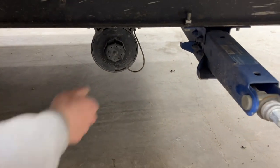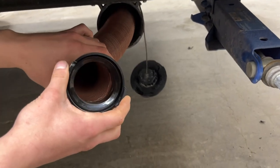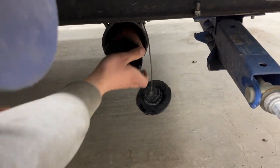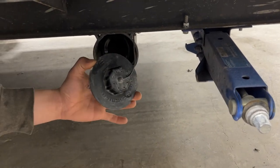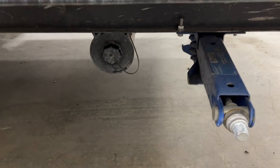In front of that we've got your sewer hose holder. There's a little knob there you can pull on and turn it out. Inside you're going to find your sewer hose. Take note of those two ears on the adapter — that's for hooking it up to your sewer system. The hose itself once fully extended is about 20 feet long. Store it back in there and you can see the little cutouts at the two sides — line those up with their notches and give it a turn to lock it in place.